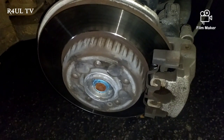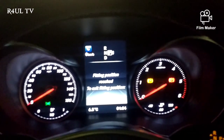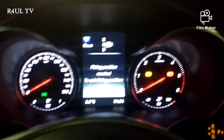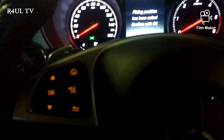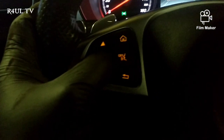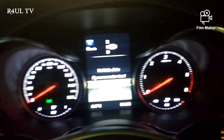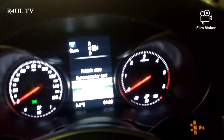Now we're going to put it back into normal position mode so you can use the handbrake. It says 'Fitting Position Reached' — we fitted the pads, everything is blinking, and it says to exit fitting position press OK. Come to the steering wheel, press OK, and it will wind itself back into its correct position. It says 'Fitting Position Exited' — confirm by pressing OK again. Happy days. We come back to the screen with Vehicle Data, Dynamometer Test, Brake Pad Replacement — just press back and that's it.